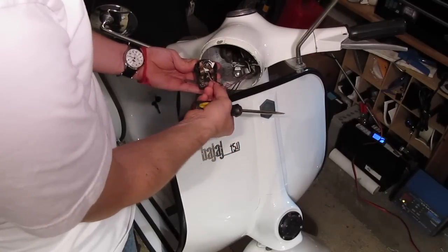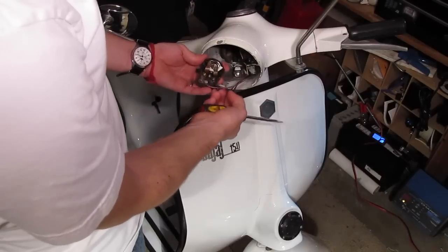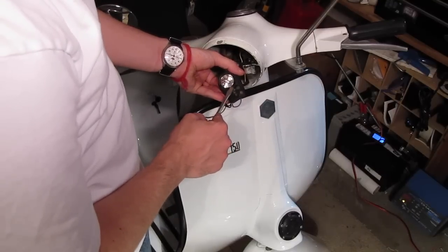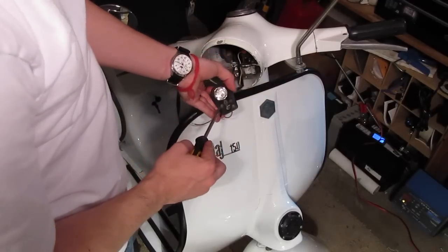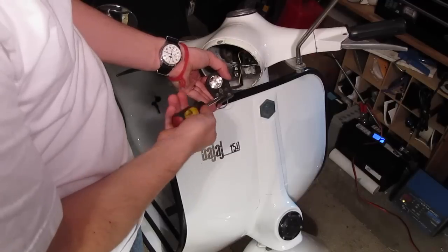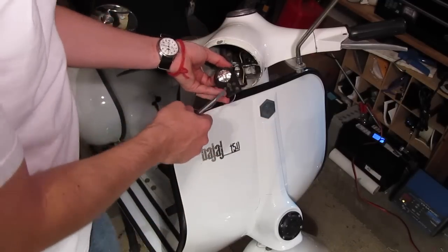Now, let's say that that's the low beam and this is the high beam. I don't want to put it here, because it'll possibly short out to ground because of that center one touches the outer rim here, that bulb. So I'm going to stow it away here, which looks like there used to be maybe a running light of some kind installed in here, which I'll revisit later. I didn't realize that existed.